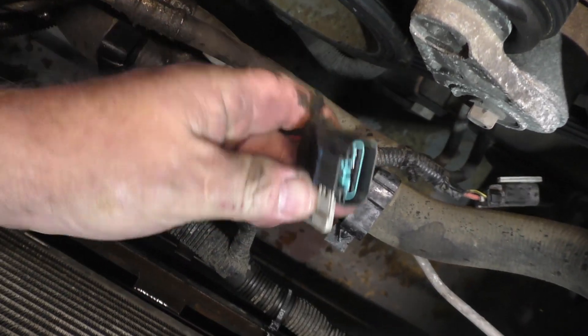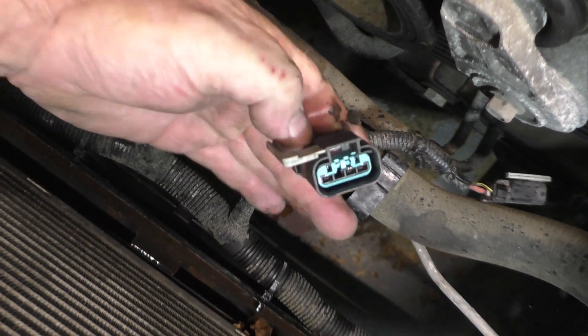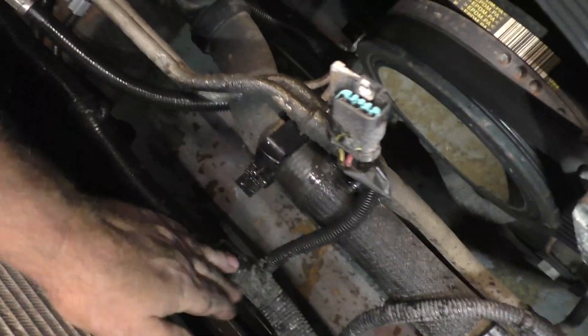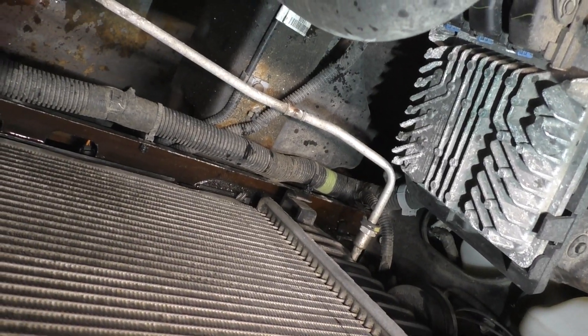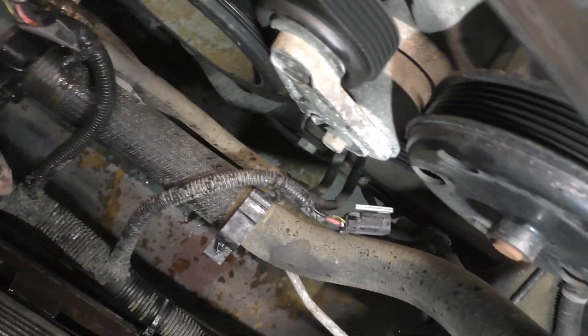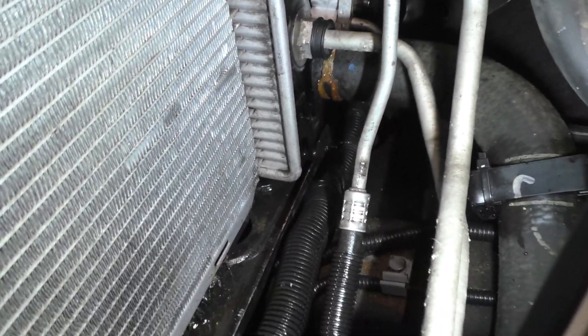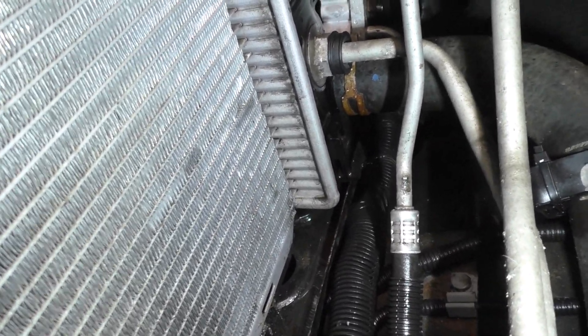Here is the slide clip — the clip slides out sideways rather than toward the bottom. You've got two of these connectors, and then all these hoses: these two here for the power steering, for the transmission cooler. The leak is down there. I had to remove all that in order to find it. Let me pressurize that — hopefully the camera can pick it up.